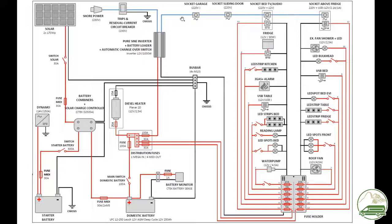Also we want to have a few AC 220 volt sockets. These we will use to charge our laptop and cameras. It's important to note that all of the appliances that need a permanent source of energy use the 12 volt system. The 220 volt sockets are only meant for occasional use like charging. Also we have a 220 volt socket in the garage just in case we need to use electrical tools when we are on the road.